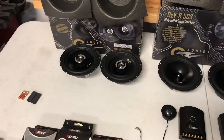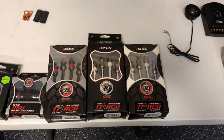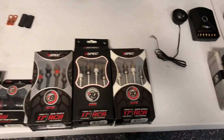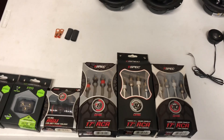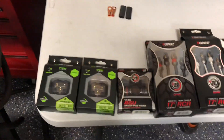So again: components in the front, coaxials in the rear doors. We'll also be using some RCAs — not the highest-end, but they are high-end. They've got a nice tight RCA connection; once you install them, they are a pain to get out. We're using a different color so that when we get to the back, we know which one is the subwoofer RCA.